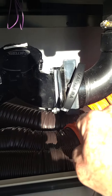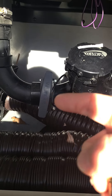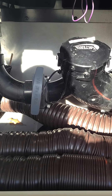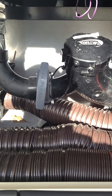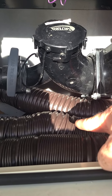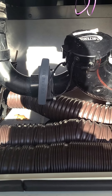Then you're gonna close that black valve and come back over here. Slowly open your gray valve again about six to eight inches and let it run until you run out of water coming out of the gray tank. That water from the gray tank is gonna help flush any solids out of your hose and down into the sewer system. That's why you do your gray tank last.